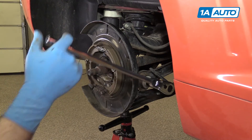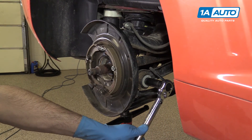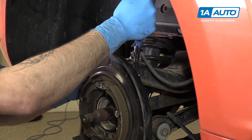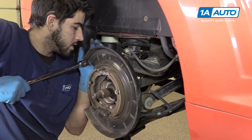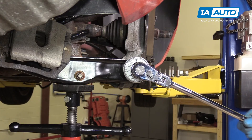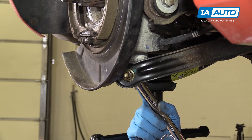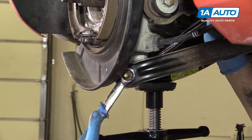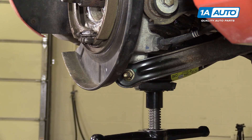We'll start by tightening down our adjustable link nut with an 18-millimeter socket and ratchet. We'll then torque this bolt to 103 foot-pounds, then add 90 degrees. We'll re-torque the lower control arm bolt to 30 foot-pounds, then add 120 degrees. The trailing arm bolt at the knuckle should also be torqued to 30 foot-pounds and then 120 degrees. I don't have a way of getting a torque wrench in there, so we're just going to tighten it up with a pair of 18-millimeter wrenches. Then lower your screw jack or floor jack.